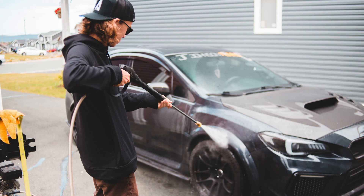Having said that, don't wash your car for the first week or so after having PPF put on — it takes a while to cure and bond with the paintwork. Unlike vinyl, which has an adhesive backing, PPF doesn't, so over a period of about a week you shouldn't be washing the PPF film. When you do wash, avoid high pressure washes near the edges of where the PPF has been applied, because it could get underneath and start to lift it, and then you'd have to have the whole panel redone.